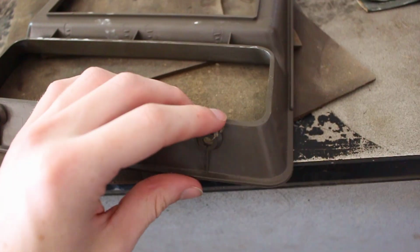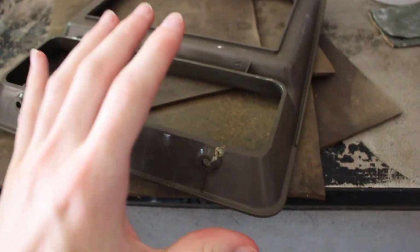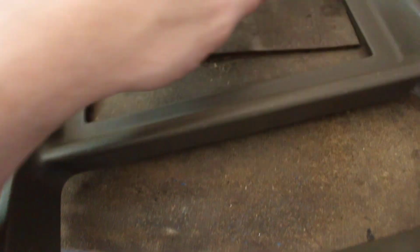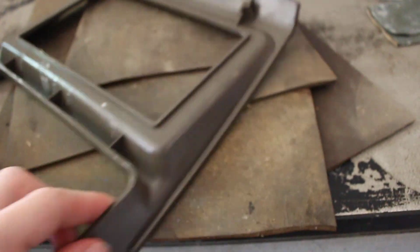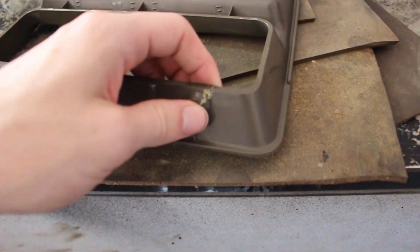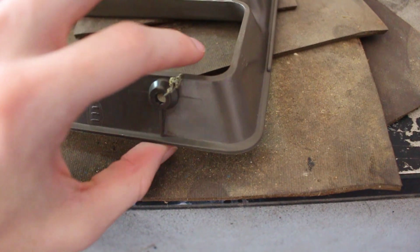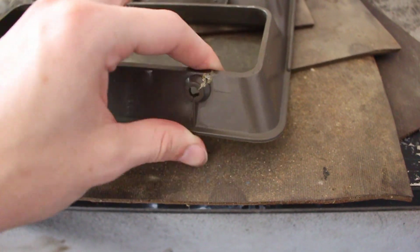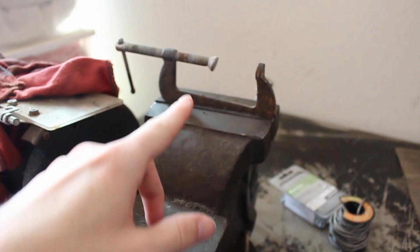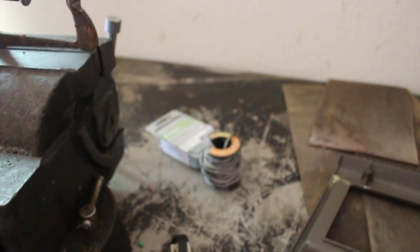What I ended up doing is I got some glue. Put a little dab on this side to make sure the glue didn't go everywhere and make a big mess. I got some tape. I put it on the side here. I did the same thing on this side over here. I put tape across the front, and then on the back of the piece I put a glob of glue there, and we put a glob of glue here. This would keep the glue from seeping through to the other side, and it would also give it a flush finish as well. So I used a C-clamp to hold these two pieces together like this, but then it was warped, pulling this way. So what I had to do is I put it in the vise here, and as you can see I have my little setup still, and we kind of just positioned it, and it was kind of like this.